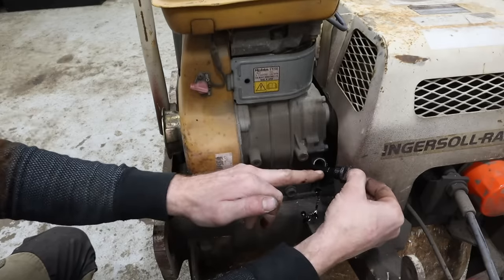So here's what starts happening when you start trying to bend a new hook on these recoil springs. See all these little pieces? You need that tight little curl to be able to hook into this piece right here or wherever. Many different recoils have different spots to hook. So you go to bend it, and you're thinking, oh, cool, I'm getting it. Awesome. Nice. You need just a little bit more, right? It's not quite enough, so you go do one of these. Oh, dang it. See? I literally was still trying to make that a hook, not just show you.